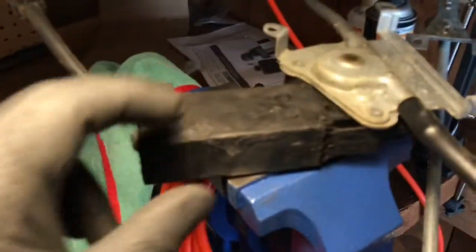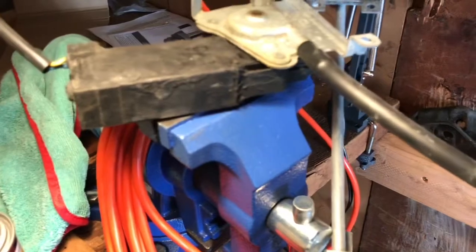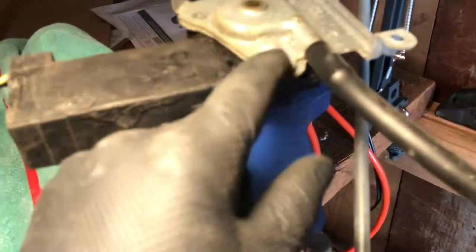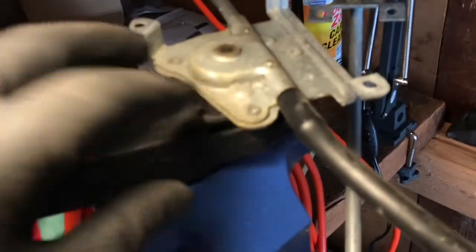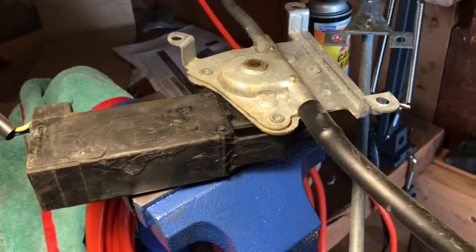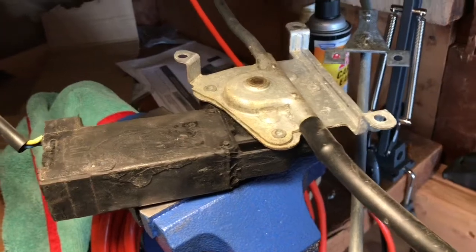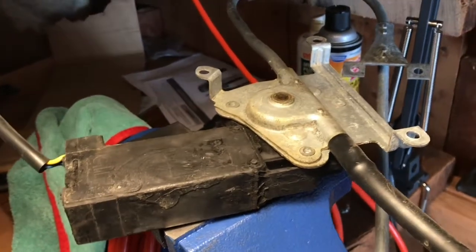Especially, I know if I'm gonna get a remanufactured motor, it's probably gonna be noisy, who knows. But put some foam on it. The plastic on the door is going to keep everything quiet. And a lot of people complain that these bolts aren't tapped when they get the new one. Well, you're supposed to use rivets, that's why. There's a lot of pressure in and out, moving back and forth. Nuts and bolts are going to loosen up. That's why they use rivets from the factory.